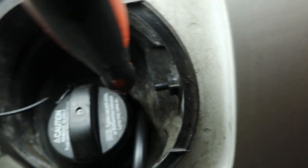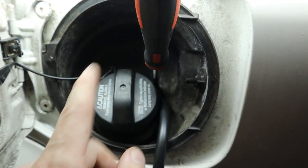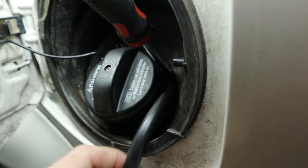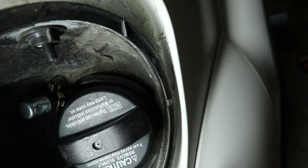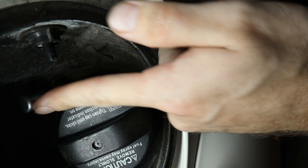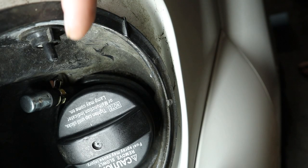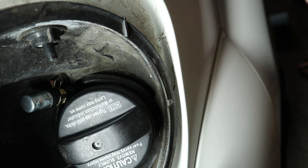Just want to show what I'm doing here. I have a screwdriver pushed up along the top edge of the gas tank area - it's all a rubber material that fills in this whole area, so it's a nice pliable rubber. I noticed a bunch of guys just feeding this hose through here, and they get to have their diff breather hidden away in the gas cap area. So I'm going to feed the rest of this hose down through there. There we go - got our diff breather located up here at the gas cap. This is a nice area, totally out of the way, and the door closes just fine. We'll go underneath and find where this hose has been fed through, dig it out, and hook it up to the valve on top of the diff.